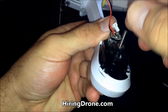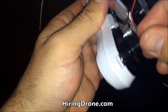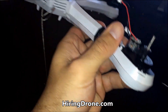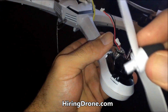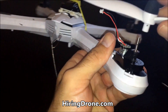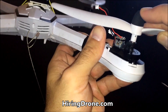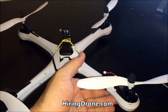Lining up the propeller is kind of a pain. You've got to get the holes just right — make sure you're going for the bigger one. When you're looking at your propeller, there are usually two different size holes. The one on the back is a little bit smaller; the one on the front has been used considerably, so it's a little easier to get in. I'm going to line the two holes up, push down until I hear it click. Now it should be secured in there as long as I don't bump it too hard.